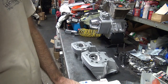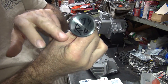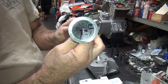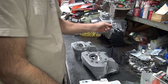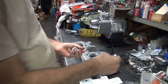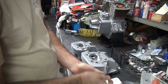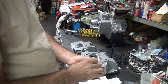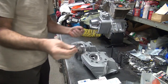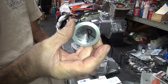Now we do our assembly. We've already previously marked the valves, so this one goes in the rear — it's got an R on it. That's an F for front on this one, and this one here is also an F for front. The other one is missing — ran away. But that would be the R valve.